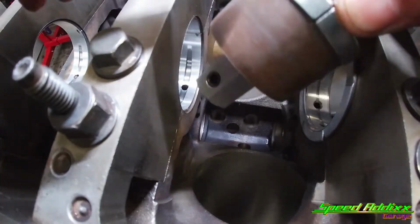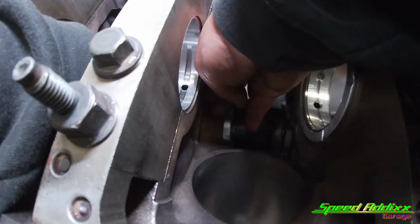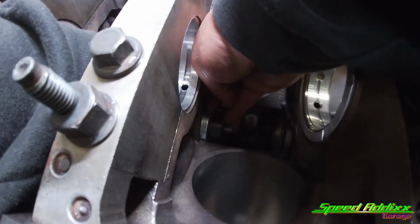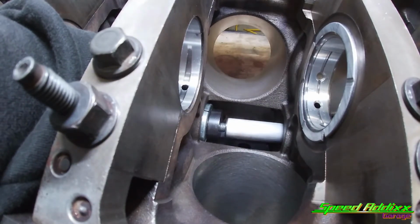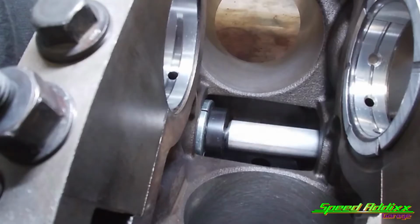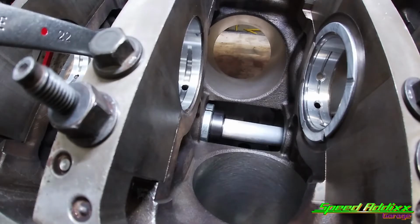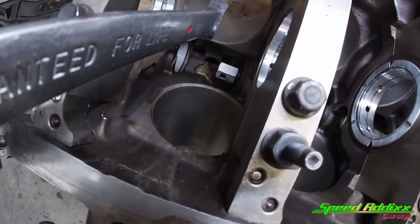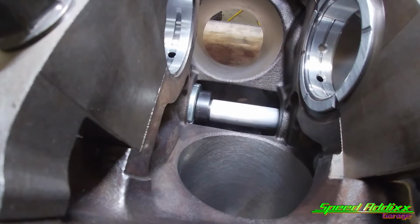All right, so the rubber side needs to go into the bearing that we're trying to take out. It sits in there like that. Then I've got the rod snaking through the front. Screw it on. Then you take the 22, and the 22 is going to go on that side of the nut. Sometimes you can hold it by hand. What you want to do is turn that shaft till it gets tight, just like that.